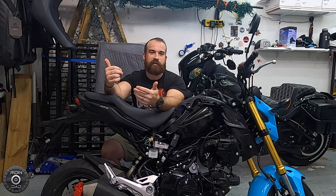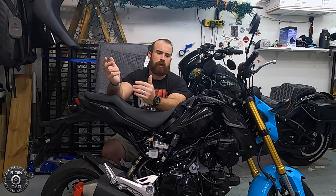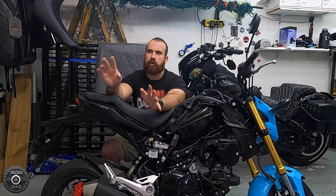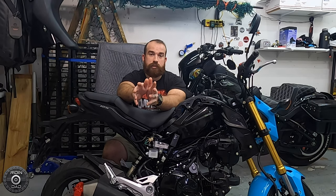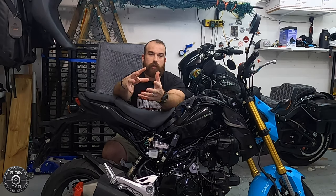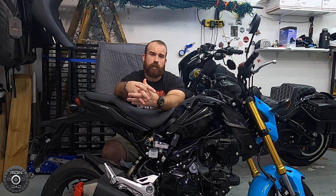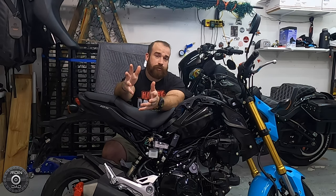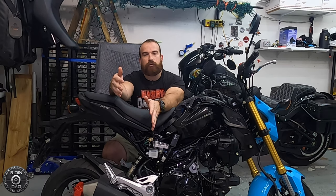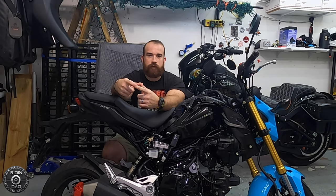We're done. You'll notice I'm in slightly different clothes and it's actually a new day, because I had some stuff going on while I was doing this — I had to put a ham on the smoker, do some other stuff with the family. I never got to completely finish it because it took way longer than it was supposed to. Like I showed you in the video, I messed up and didn't seat the clutch basket together correctly with the plates and everything. Because of that, the springs didn't do what they were supposed to do when the clutch was supposed to engage, and I could not figure out for the life of me what was going on. I thought originally it was the Chimera lifter plate — that I didn't do something right with it or maybe it was out of spec.